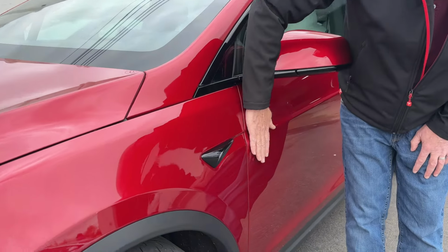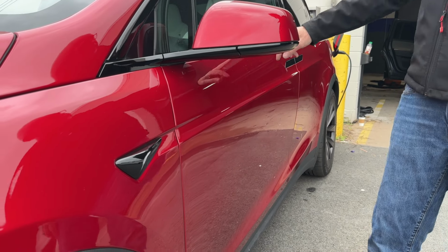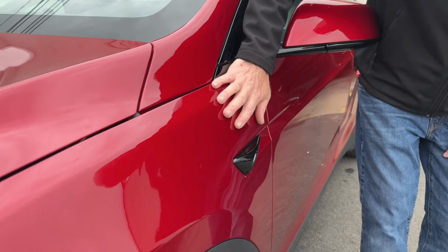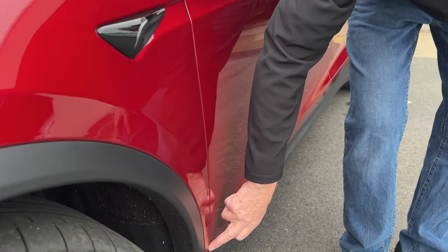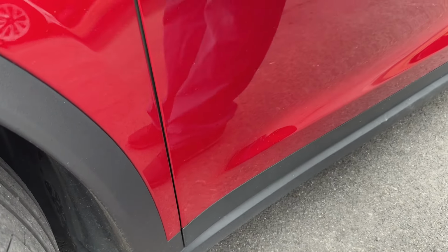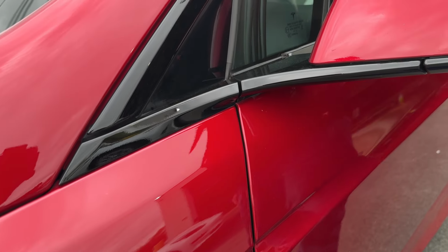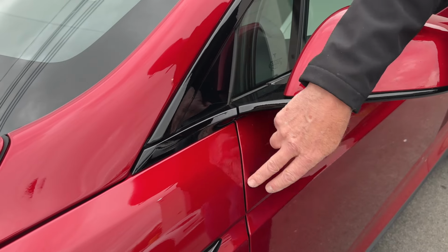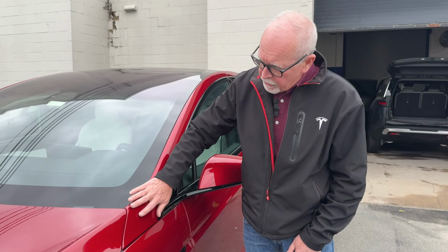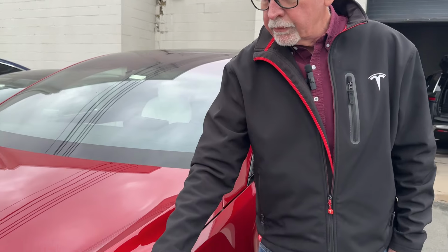If we think the Falcon Wing door fits the quarter, cool. And then if we think the door fits the Falcon Wing, cool. Let's go to the fender and say, does the fender fit the door? Well, if we look down here, we're probably less than 2 millimeter gap here, and it works its way up to roughly 2.5 or 3 millimeter gap. And so again, we've got what you would call a V gap, wider at the top, narrow at the bottom. Could you adjust this? Certainly could. But now we come back to the panel that doesn't move, right?